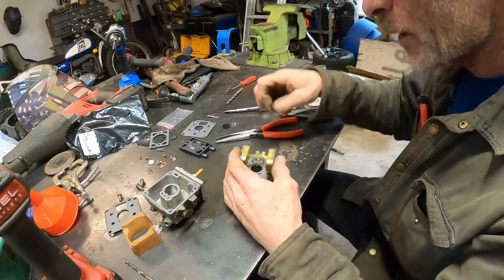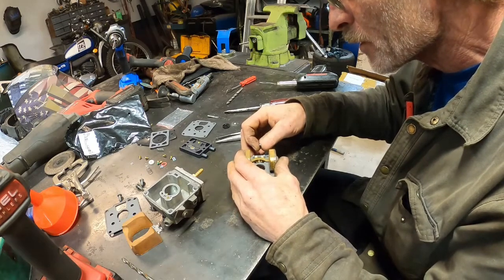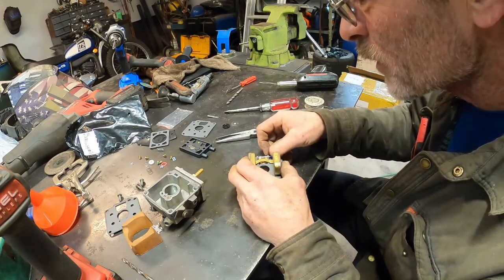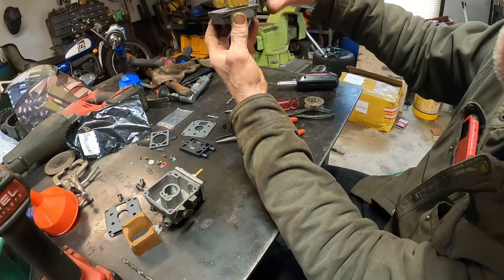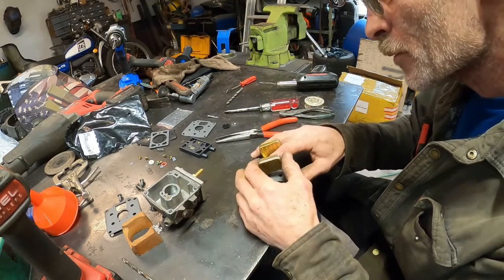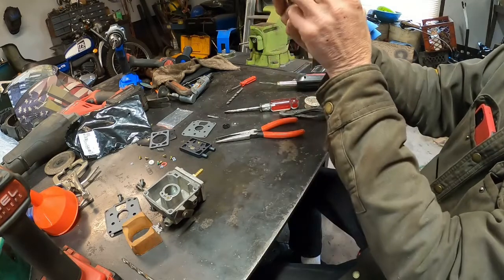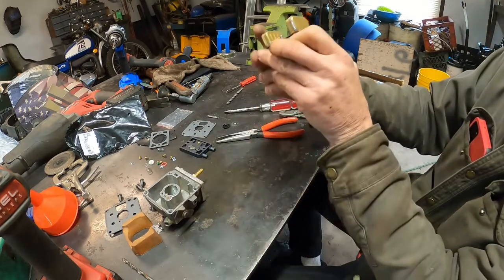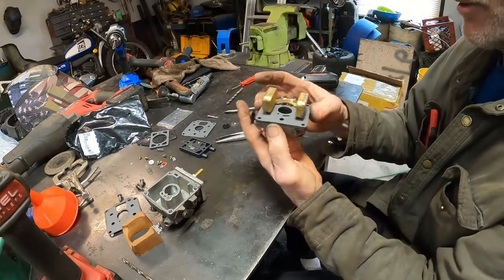Let's see. I'll show you what we got here. Gonna get it hooked first. There's two little hooks there. Gonna get it in them. Now, you want the floats to be kind of level to the top of the carb. And we're pretty darn close there, and not bad. That one's a little high yet, but I can fix that. A little finger under here, a little push down. Let's see what that looks like. It actually went too far, but now we're kind of in the center. Let's see. How's that? Yeah, we're pretty good there. Okay, so the float is installed,